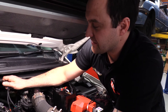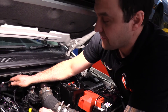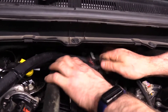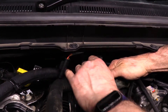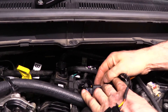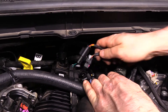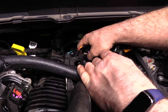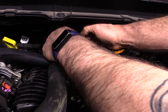Now that the map sensor's done, we're going to move on to the two sensors on the engine. First one being the cam sensor — the tricky cam sensor we spoke about. Move the hoses out of the way and try to keep the harness neatly tucked in with the hoses. Find your cam sensor plug in the harness, plug that one into the cam sensor, and then obviously the corresponding plug for the cam sensor into the Unichip harness itself.